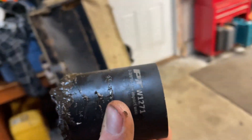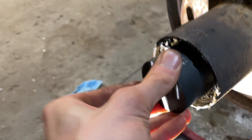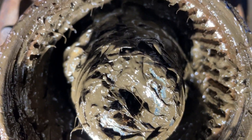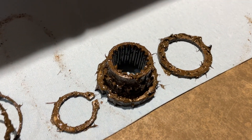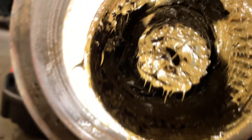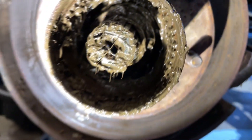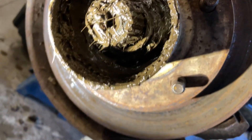You can see there's a little groove back there. Now you need a certain socket - it's a two and three-eighths with four little prongs sticking off it. Wiggle it in there - boom - grab your half-inch ratchet and back it right out. There's actually a snap ring here too - you can see the two tabs right in front. Pop that snap ring off, that whole piece comes out, and you just slide it right out. Then there's another bolt behind it that we need to unscrew.